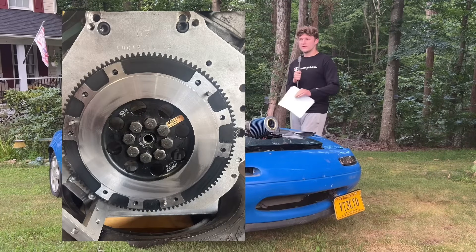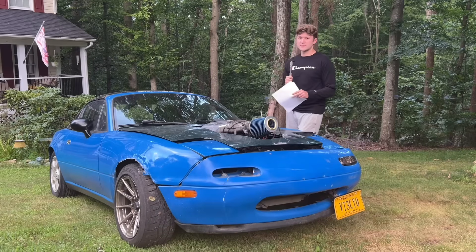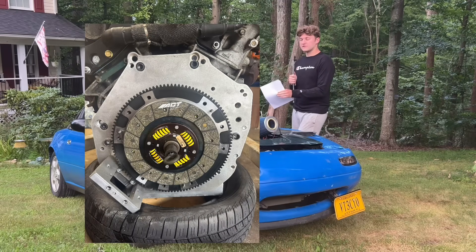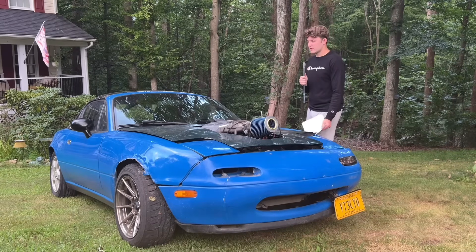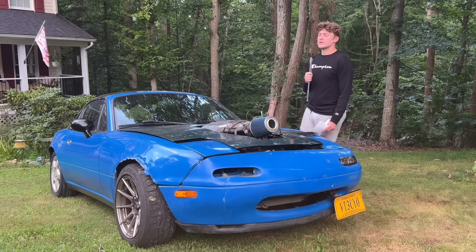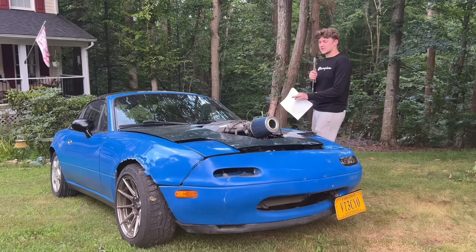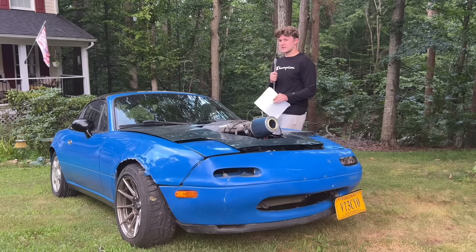This did require some minor clearancing to the transmission and really left my garage full of aluminum dust — so wear your PPE, wear a mask, safety glasses, but get ready for a wild cleanup. The power is transferred from the engine using a Honda B-series type clutch setup. This uses a lightweight flywheel from ACT — beautiful piece, this is where you want to spend some money — and a custom Miata B-series clutch that utilizes the Miata spline for the 5-speed and has the diameter of the B-series.